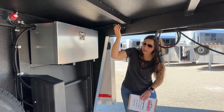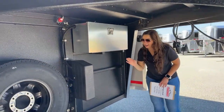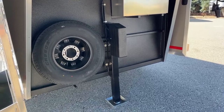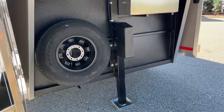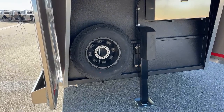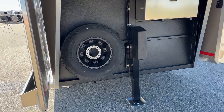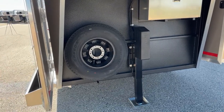When you're sitting there cranking in the heat of the day, it just comes in handy having that electric jack and being able to get that trailer up and down with ease. The nice thing is when you plug it into your truck and your truck is running with the battery cutoff switch in the on position, it's going to trickle charge that battery. We always recommend, especially on longer trips, get that battery cutoff switch on and make sure it's plugged into the truck — that way as you're traveling, your battery is going to be charged back up.